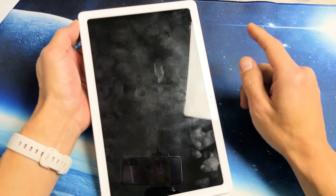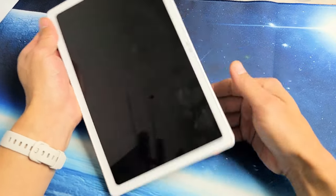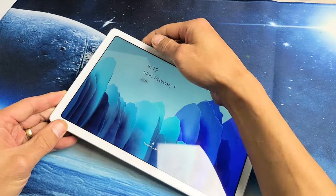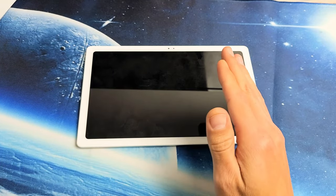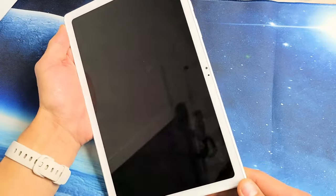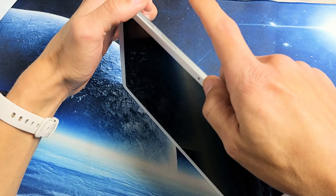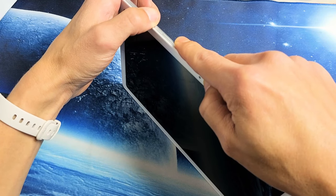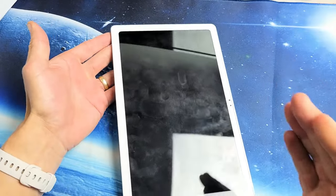If you're still down, the last method is the freezer method. Grab your tablet and put it into your freezer. Wait 10 to 15 minutes. After that, pull out your cold Tab A7 and force a restart — press and hold the power button and volume down, do not let go until the Samsung logo appears, then let go. Hopefully you're up and running.